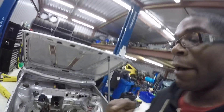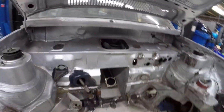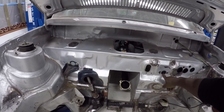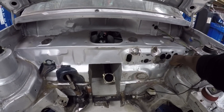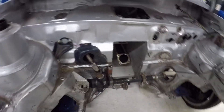In between then and now, I've fitted the brakes which are now 312 millimeter discs from a Mark 4 Golf 4Motion. I've started doing some of the engine bay stuff — I've fitted a new battery tray and started blanking some of the holes that were there from the previous engine. I've now just got three holes for the loom that need blanking: two are for the engine loom and one is for the engine compartment loom.